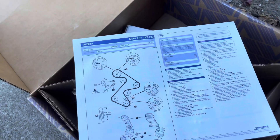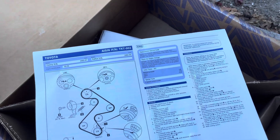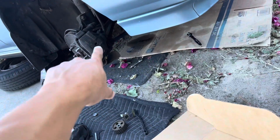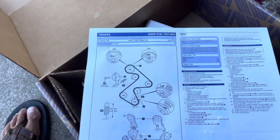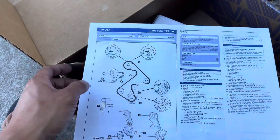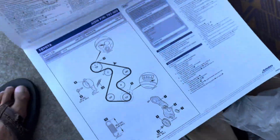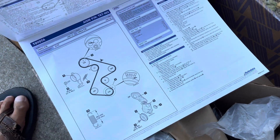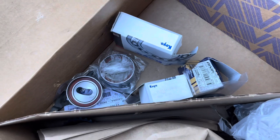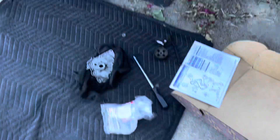Got all the parts. I bought the AISIN kit — a little hack for getting parts like serpentine belts. AISIN makes a lot of Toyota parts — you can even see AISIN on the caliper — and they're actually cheaper than buying Toyota-specific parts, same OE quality. The kit comes with the timing belt instructions; ours is the 2.0L 3S-FE engine. Got new bearings, seals, belt, and water pump.